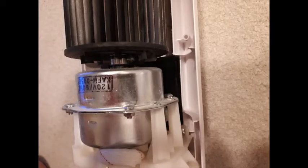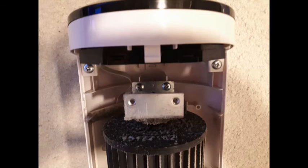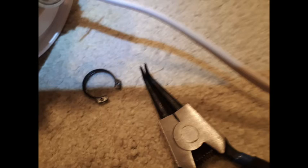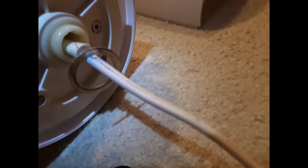Once it's off you'll have a look inside the fan. The motor is located at the bottom, and the spinning fan itself is attached to the motor. At the top of the fan it's held in place by a couple of screws in a bracket, and above that bracket you'll find a little black box which contains the circuit board. At the bottom you'll notice a spring clip and a little washer that hold the bottom of the stem in place, and you'll need to remove that clip using snap ring pliers to slide off the small silver round washer.